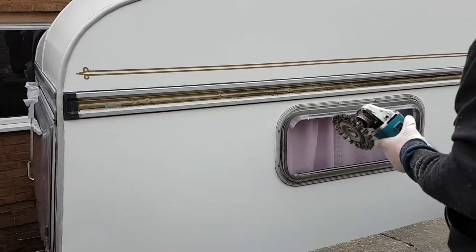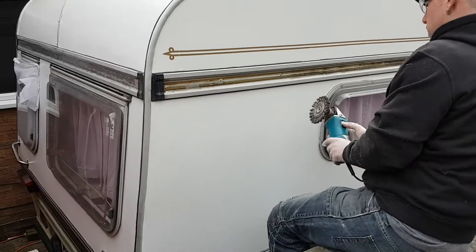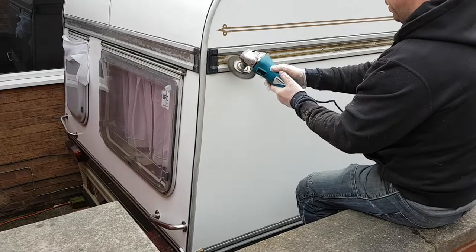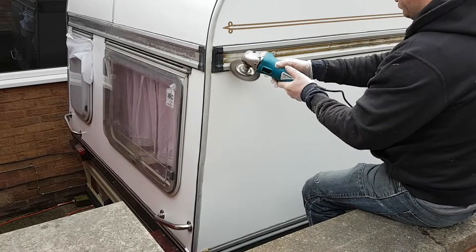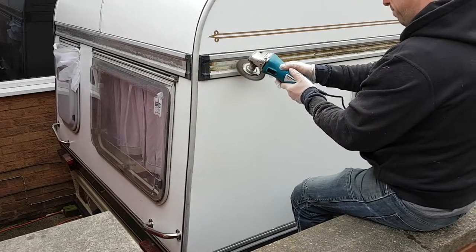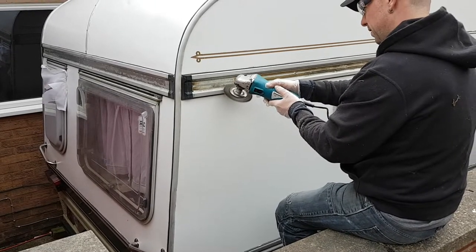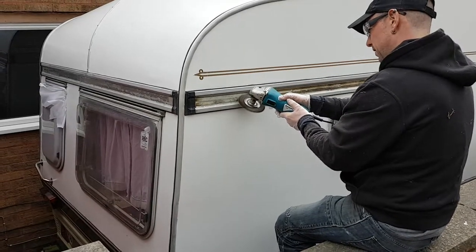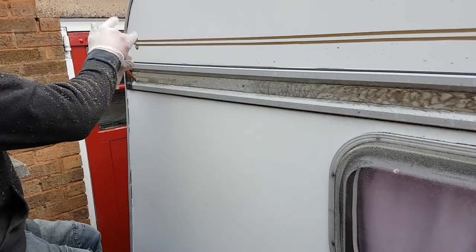Now to the trim that we should have done first. It's very, very messy, and all of this old adhesive has to be removed before we can stick the new trim on. So we're using a grinder with a wire brush attachment to try and remove it. It took a very long time, but it had to be done, or we wouldn't have been able to attach the new trim very well. Trim goes all the way around the caravan, all four sides, and it all looks like that. So it all had to be ground down,